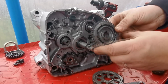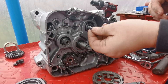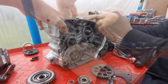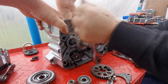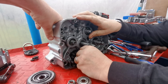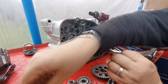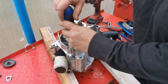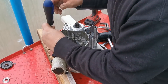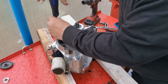That's a rubber-mounted gear isn't it. Right, so you know where that comes from, and there's also a little woodruff key in there as well. That goes with that one. So we've got the selector rod - there we go, go through there. And that should pull out. Right, so there's 14 bolts that hold the two crankcases together. They are different lengths, so you can probably only drop them in a certain way.